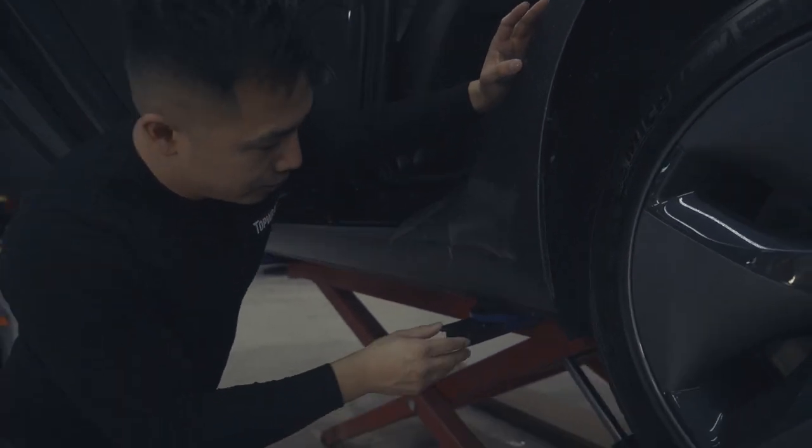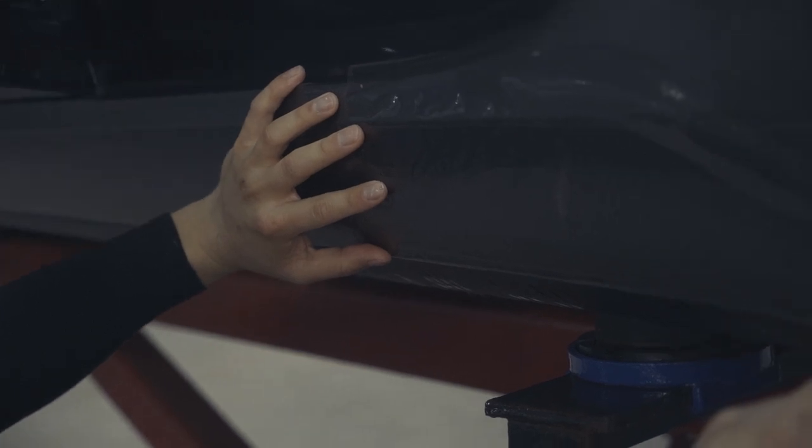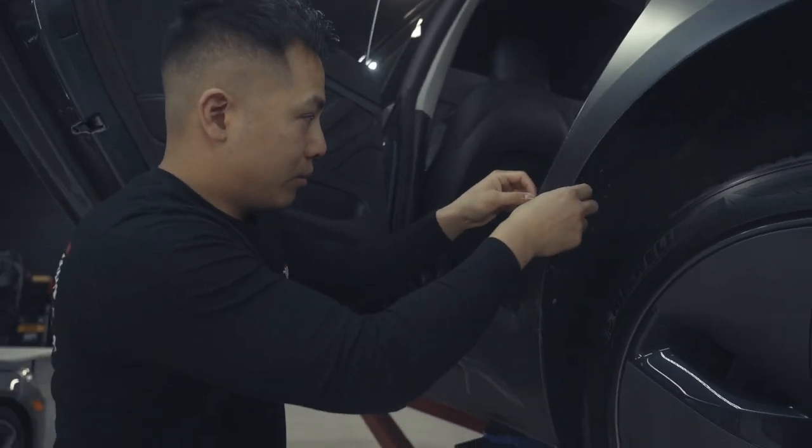This kit is designed so that this corner — the nipple piece — fits into the new generation Model 3. The latest Model 3s have an extra layer of paint along the bottom, and this nipple fits directly inside that piece. Fit it there with even spacing all the way under, and it goes all the way along the bottom with just a little bit of wrap — that wrap is what you need to really protect the edge of the car.